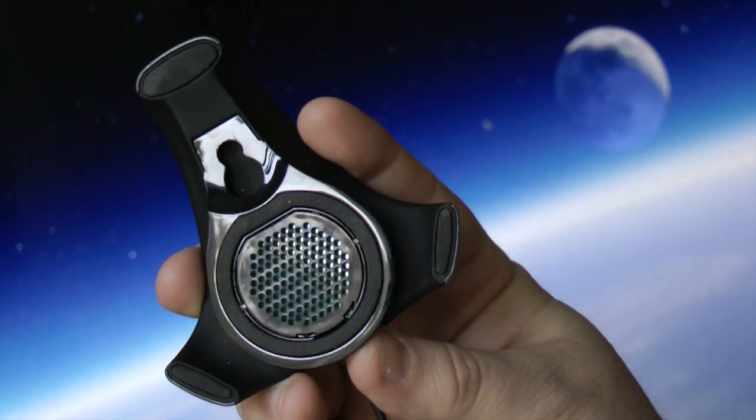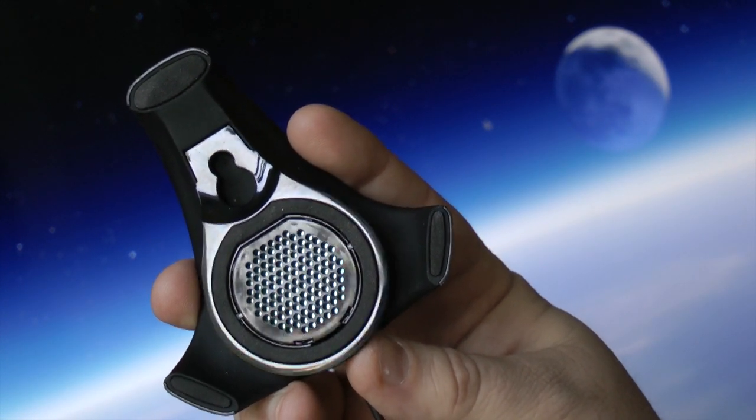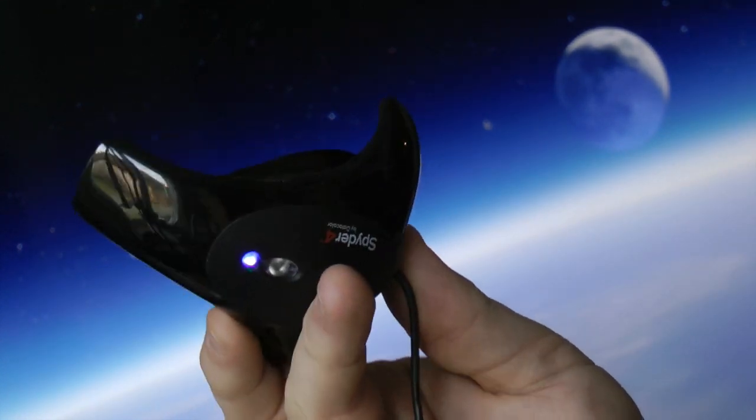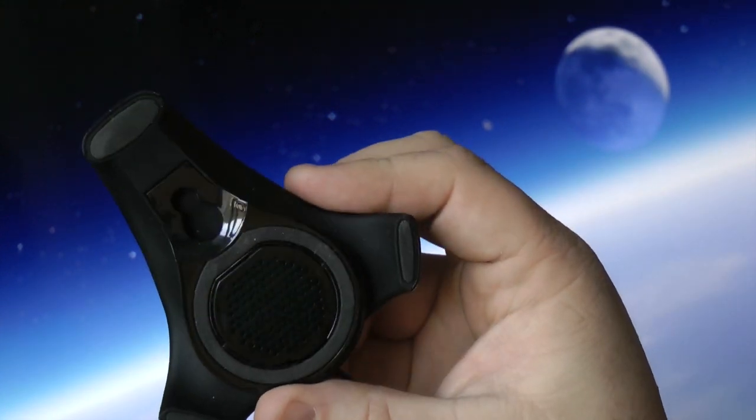So it's very important that a calibration tool like this one will also measure brightness as well as color. The Spyder 4 does do that. One of the steps in the calibration process is going to be checking how bright your monitor is and guiding you through the process of setting the brightness to an appropriate level so that you've got good light and dark values in the images when you're editing them.